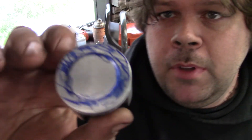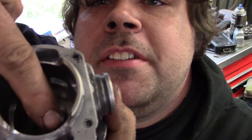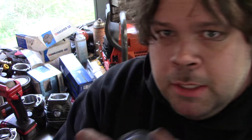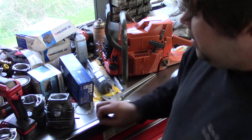Now a real critical thing you want to do — I put blue marker on this for a reason. I did this in a video because I machined that piston on the Harbor Freight mini lathe I got. The reason why I did that is because when you machine the pop-ups, you want to make sure that down inside the cylinder here you don't hit against that combustion chamber. In this piston, I know I'm hitting right here on the squish band area. You don't want to hit right around that pop-up. I got that one set at about 20 thousandths. This is one of the cut-off pieces of solder I used when I was checking my squish.